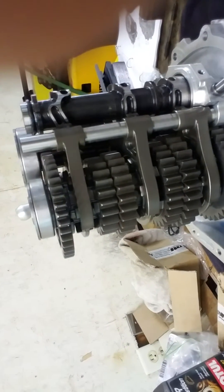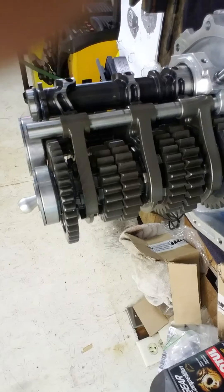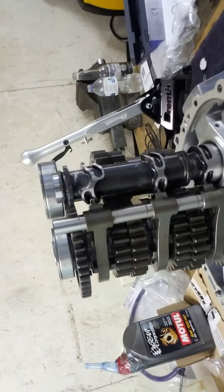You don't want the transmission to kick power back in when it's not in gear, because you could cause serious problems — you could eat up those dog teeth. It's very important that the transmission is back in gear before the power comes back on. This system makes it kind of foolproof for the driver, and it will not kick power back in until it knows it's in the next gear — and that also makes it quicker, giving power back at the soonest possible point.